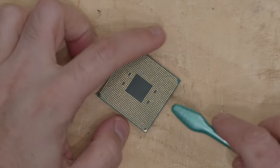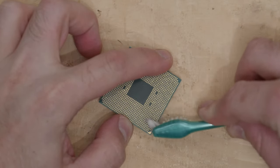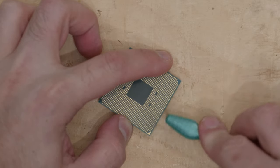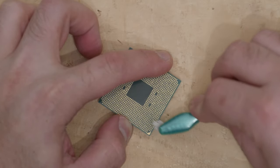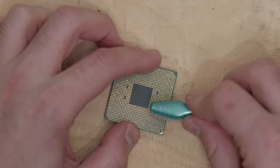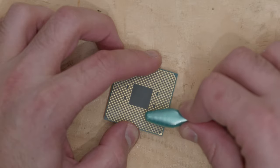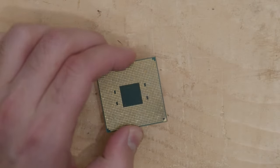The first thing I'm going to do is take this toothbrush and brush the thermal paste that's in the pins away from the rest of the CPU towards the edge. I'm going towards one side and I'll go to the other nearest side in a minute. I'm lifting up the toothbrush and only brushing away from the CPU, being very careful not to put too much pressure down — doing this by feel, very gently, so that I know I'm not bending or breaking any pins. They're pretty tough compared to the toothbrush bristles, but you should be gentle. You only need enough pressure to get the bristles to that green part of the PCB — not much more than that. You don't need to press hard.